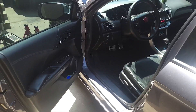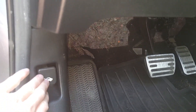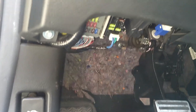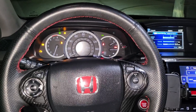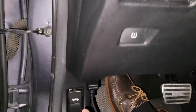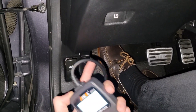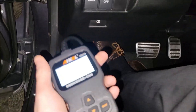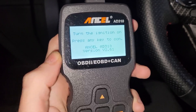Looking down here on the far left side, you'll see it right there. Now that it's daytime, I'm going to show you guys how to quickly locate where to plug in. It's going to be by your hood open release there, and if we look under, it's going to be right there. So just for a better look — I have it plugged in there and it's right here. Keep in mind the little plug-in point can push up, so just make sure to work it down with your hand. Then it's going to tell me to turn the ignition on and press any key.